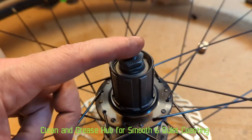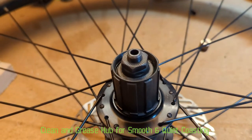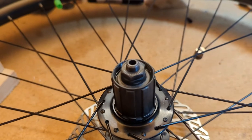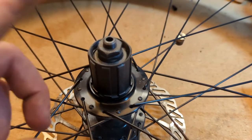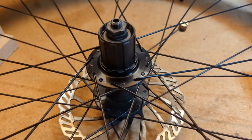Be liberal with grease. Without getting into too much detail, the axle comes out and allows you to access the bearings. Those come out, everything gets cleaned as best as you can — you can even use a solvent to break up old grease and pull it out. Bearings have been repacked, everything's fastened down, and now it's ready for a cassette.